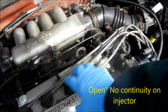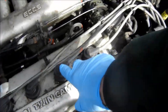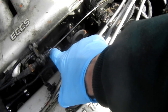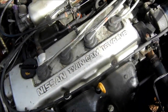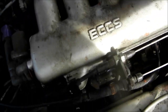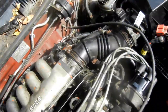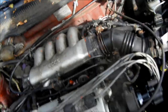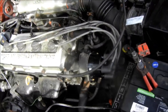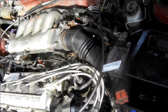I basically pulled all these to see which one made a difference. When I pulled this one, nothing changed — it was still a rough idle or missing. I pulled the plug and could hear the noise in the cylinder, put a meter on it, and it was open. Otherwise it was running great. In order to take that one out I had to pull the manifold off — five bolts plus two underneath. I haven't really done anything to it since yesterday and it wouldn't start then either. I'm thinking it has something to do with the fuel pressure, so I ordered another fuel pump just in case.